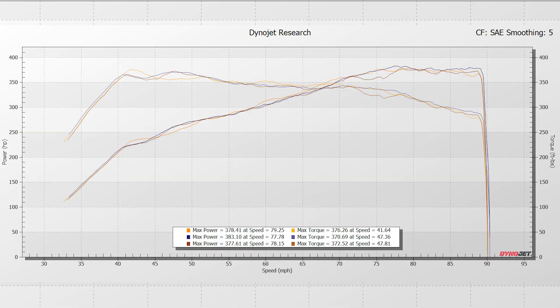We just finished our test with the Cobb top mount intercooler on the WRX, and the main takeaway is that the Cobb top mount is very consistent. After the very last pull, the charge temps were still dropping the same way they were after the first pull. One thing to keep in mind is this dyno room is not a perfect environment, so the airflow isn't exactly like it's going to be in real-world conditions. We also didn't install the hood duct that Cobb provided, so I'm sure if we did that, it would have performed even better.